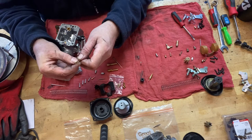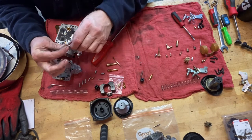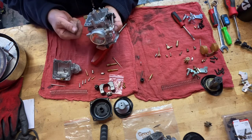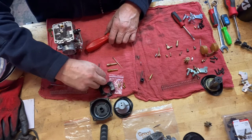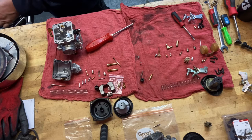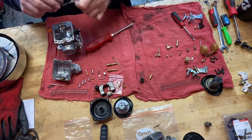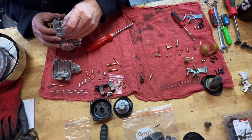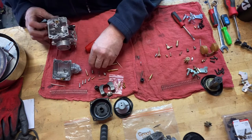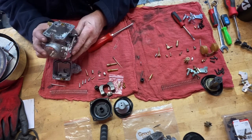This is one thing I'm going to change over to — a thumb screw for the mixture adjustment. Evos can be a little bit temperamental and more finicky to tune than something like a W650. Then there's the usual screw, washer, and o-ring — the o-ring always gets stuck in there. If you're working on carburetors and need to get that out, take a paper clip and give it the tiniest hook, then reach in, feel the o-ring and pop it out — hopefully without dropping it inside the carburetor. New fresh o-ring in.